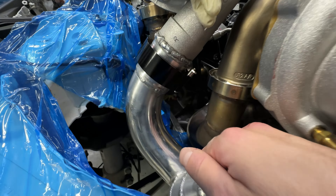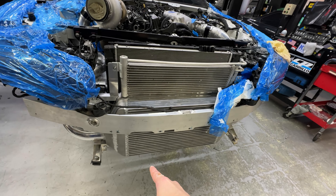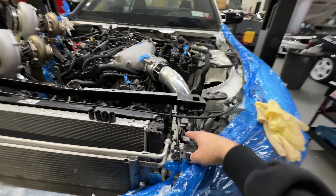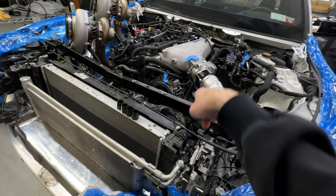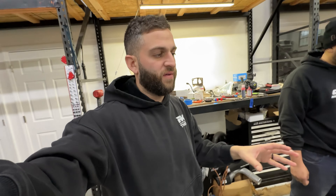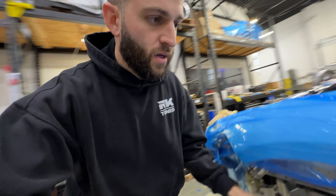We're using these little knockoff clamp fittings. There's a massive front-mount intercooler on the car. This is a factory transmission cooler relocated — we do have to make lines here to fit it back there. Nelson welded on new fittings down there. We had that welded previously but the fitment could have been better, so he redid it.